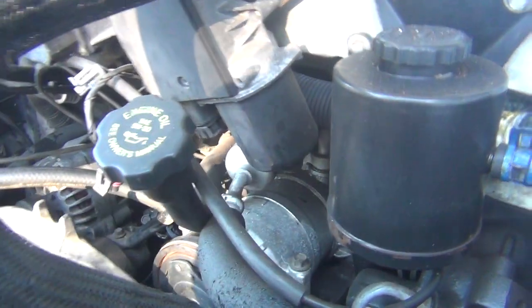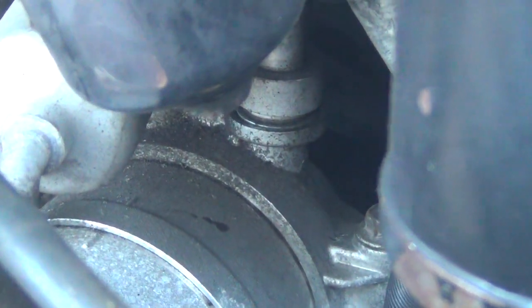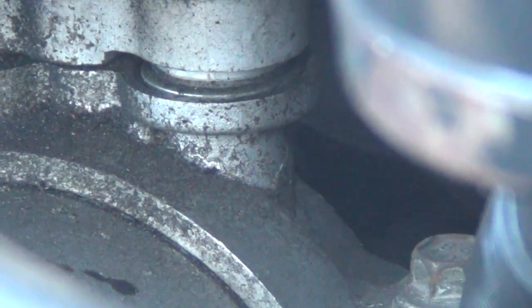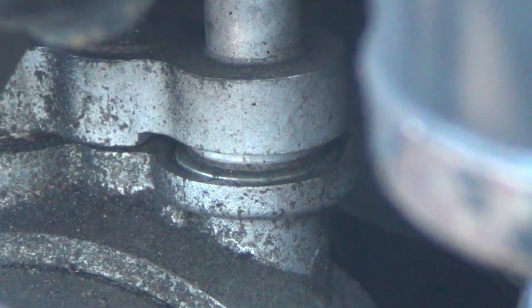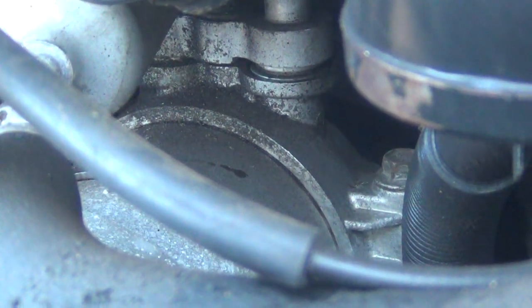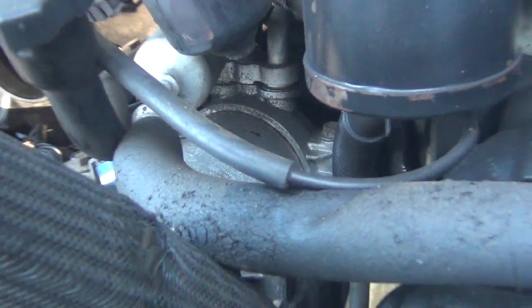You might be able to see it right there — Jose's gonna fix it. See where that oil is on top there? That all leaked out from that brand new compressor. There's two rubber seals there, it looks like one's pinched out. There's one on each side. I got those from the dealership — the right ones — but they're made in Mexico. They were $21 for both. He's gonna replace those, suck the system down, shoot it back up — it should be freezing cold again.